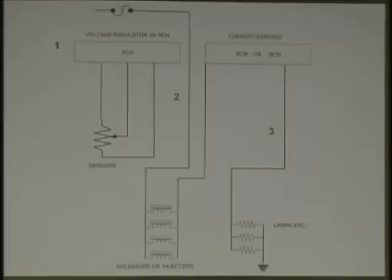And don't forget, if you put the wrong bulb in a vehicle like a Toyota third brake light, you're going to burn that little module out. Do that in a BMW, you'll burn the light computer out. You do that in some cars with reverse lights, transmission issues sometimes pop up. Make sure you put the right bulb in the car. There are lamp guides available, or nowadays you get all the stuff online. Not every bulb is available, especially on new cars, other than from the manufacturer.